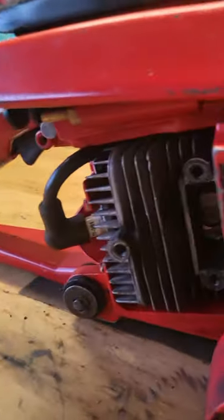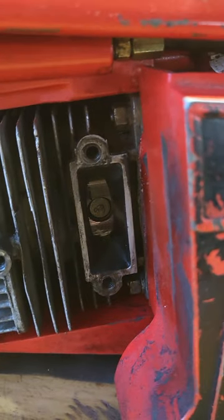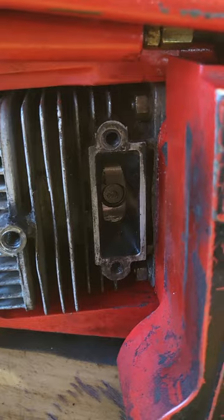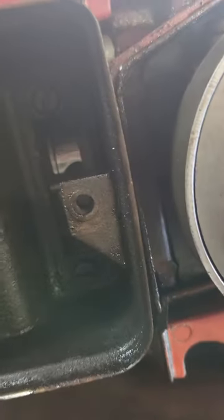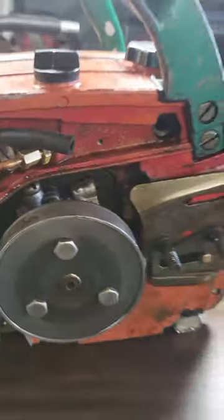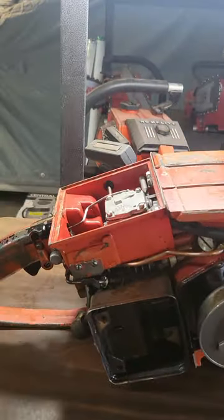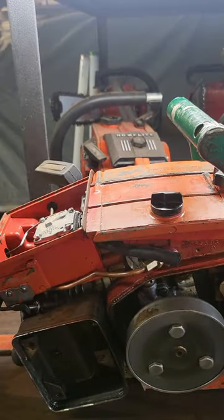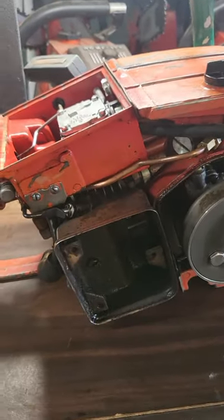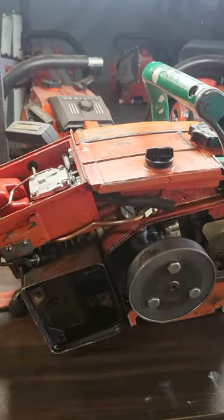Now this one on the 904s and the later 924s are different, and the VIs are different. The VI is like the Super XL925, and if you'll notice on this muffler port, there's no dividing bar here. But on the 904, 901s, 903s, there is a dividing bar in the exhaust right there. And it's a little bit different spacing on the screw holes, so some will work and some won't, but definitely this muffler body won't work on a VI 955. That's like the Super XL.